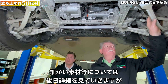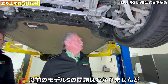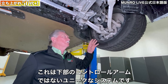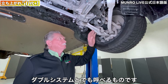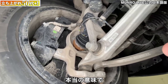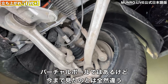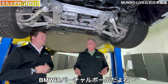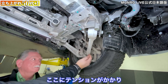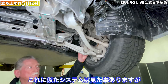We'll probably give you a lot more detail on materials, and that gets us to the front suspension. I don't know an awful lot about the problems on the old Model S, but this is a unique system — instead of having a conventional lower control arm it's a double-link system. It's called a virtual ball joint. This here would be your tension link because as you're driving the force is pulling the wheel back — this one is in tension, and this would be your compression link.